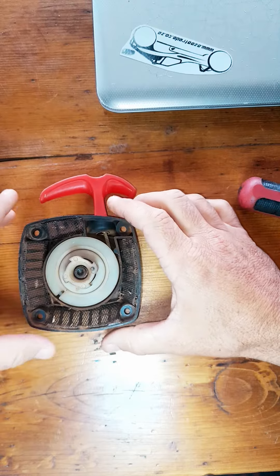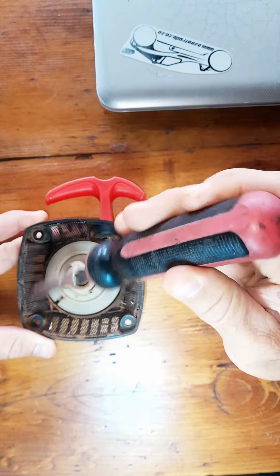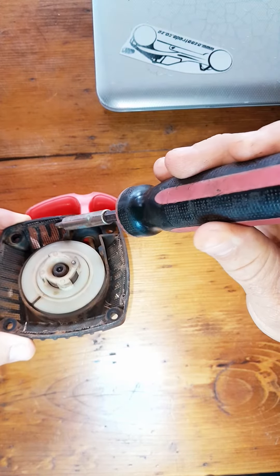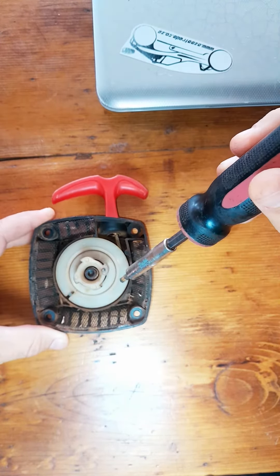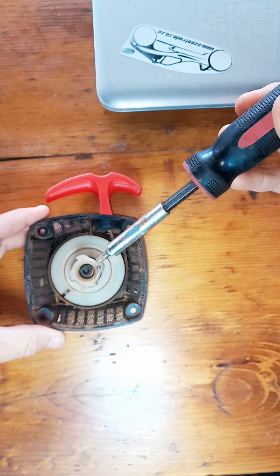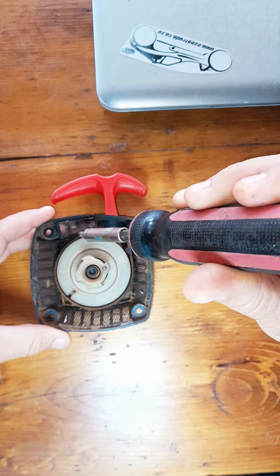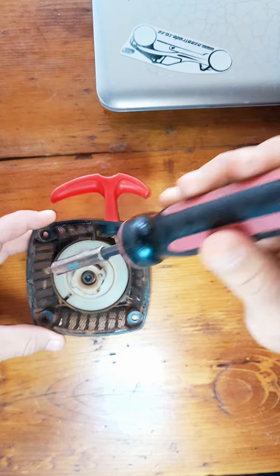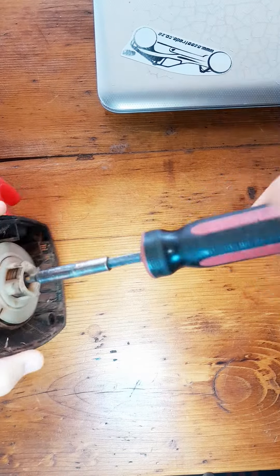This is mine off my car — as you can see it's modified. I buy mesh from the hardware store and super glue it in there. Just remember this is useless if you don't do the same on your crankcase, because the grass will just get sucked up into it. My crankcase uses outerwear pre-filters, and this mod on my pull start works fantastic.